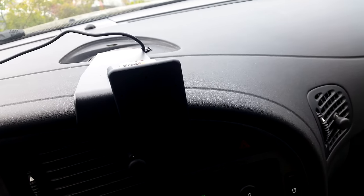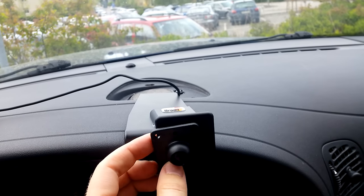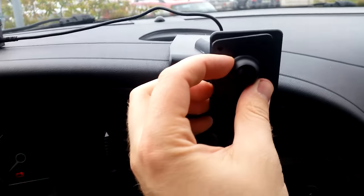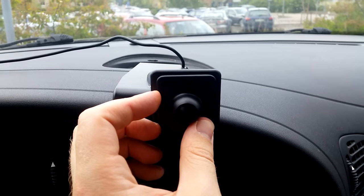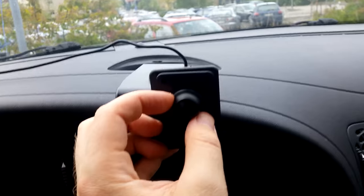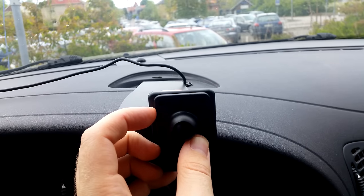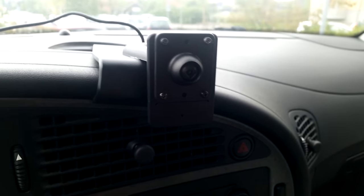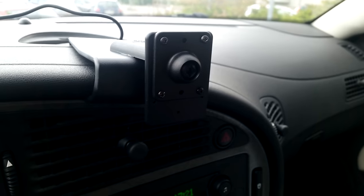I think it's quite easy here in the car. You detach the main middle screw from the phone holder, get this part loose, and then you put it up against the bracket. You will need to ensure that the middle screw is pointing outwards. You have a little bit of choice where you want to put it — I'm just going to put it quite high up in the middle — and then you'll use the screws to screw into the plastic. This is the only part which is somewhat destructive; you will actually incur some damage to the mounting bracket, so be sure to get everything right from the beginning so you don't have to redo the screws. Those four screws are probably the hardest part of this install — they're really small and need quite a bit of force to get into the plastic — but now they're in and they will never let go.